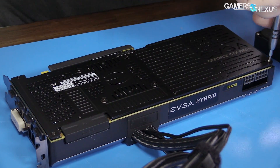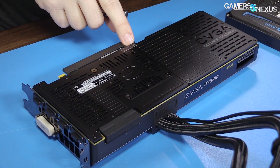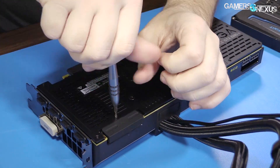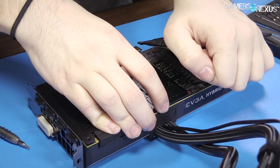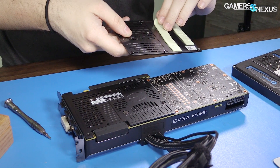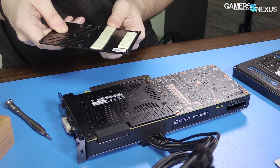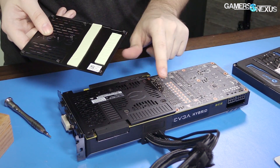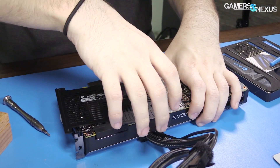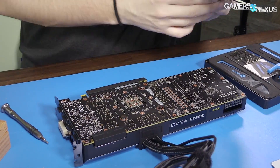There's no evidence of us going to the tamper seal. They're sticking with thermal pads on everything — this one's on the back side of the MOSFETs and maybe the chokes. That one is on the VRAM right there; you can see the grease outline. So that's half the backplate off. The other half is also stuck on by lots of thermal pads — back side of the GPU, VRAM, VRAM.